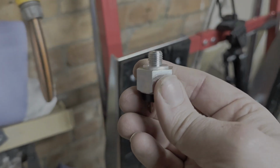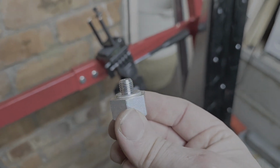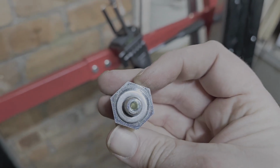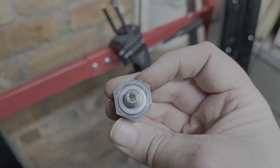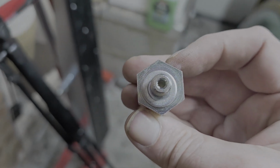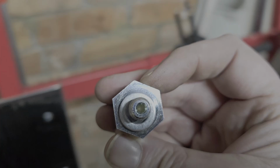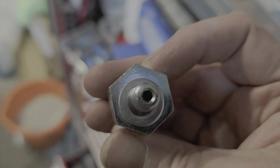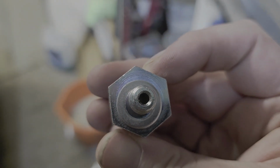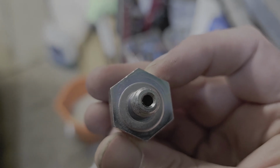The repair for this is basically unscrew the old one, put the new one back in. It's going into the hydraulic line, so we're going to have to make sure that the brakes work fully and safely before we take the car out. It may involve bleeding the brakes. However, we'll get that done and we'll see if it makes any difference to the brake lights.